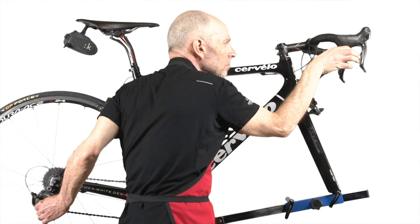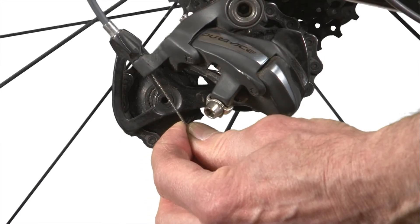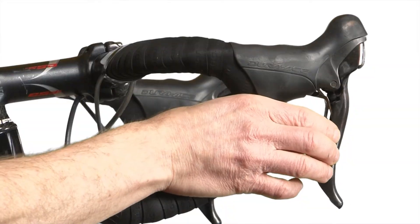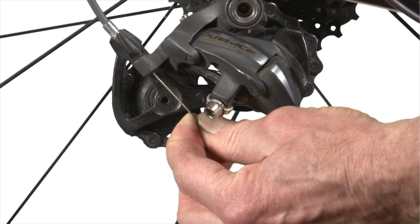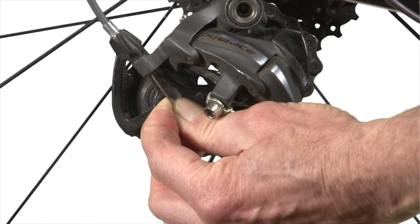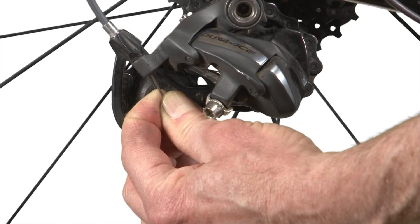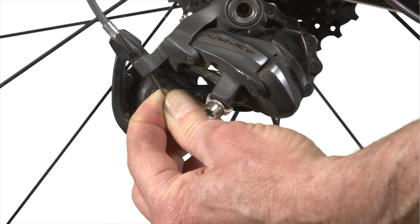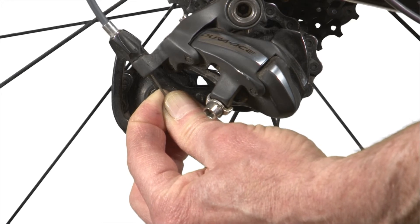With your left hand on the cable, shift up through the range of gears. Gently pull on the cable to simulate the spring mechanism in your derailleur — a gentle pull is all that's required. Click the shifter up and tighten the cable, feeling the cable getting shorter on each click. Once you've reached the end of the range, start shifting in the opposite direction and the cable should get longer. Remember, put gentle tension on the cable; don't pull too hard, because what we're trying to detect is tension in the cable.